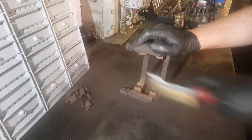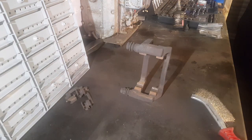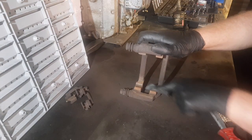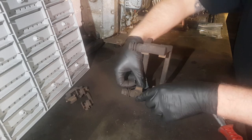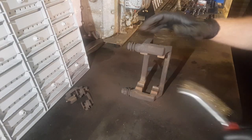Run your finger along it and you can feel any roughness. Grab some emery tape and just rub off any lumps or rust buildup, and clean it back. It doesn't matter as long as the pads go in nice and loose and they're not tight — then there's no problem.